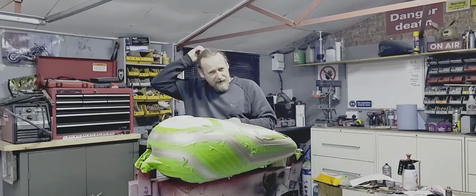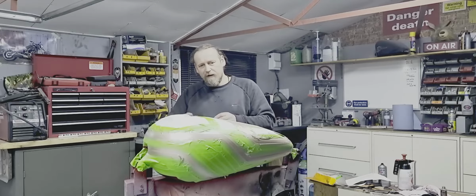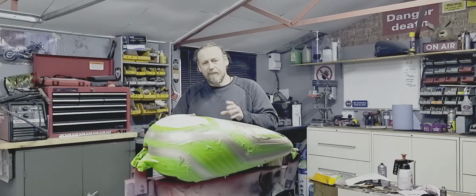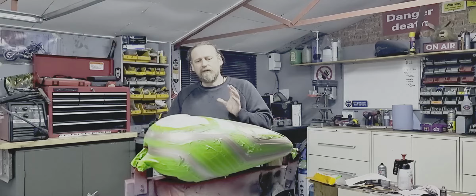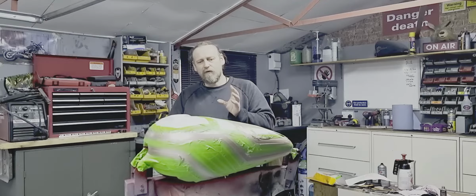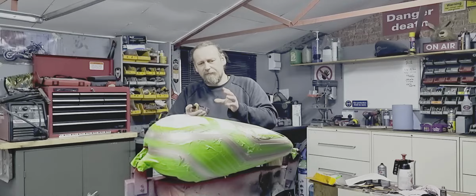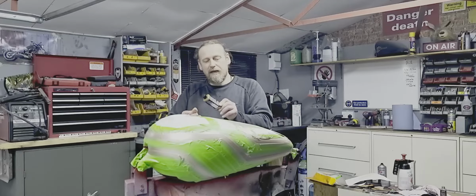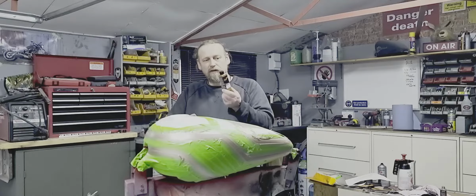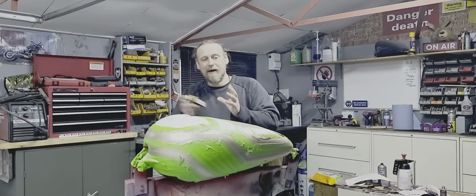Okay, so my initial reaction looking at that against the test piece on the ruby red is I'm not overly happy, which is why, of course, I always use 2 or 3 paints. I don't think the colour's going to match. I really thought it was going to work, but rose gold can come in different colours, and this one's just a little bit too light for me. So we're going to use that as a base coat and then go over with a base metallic dark gold, of course. And that should give us the definition that I'm after.